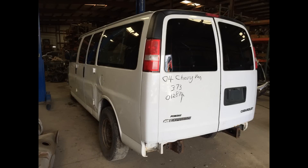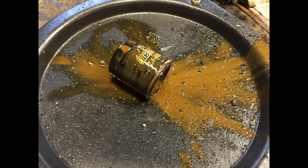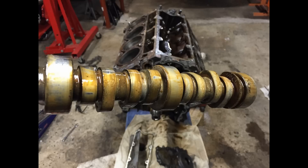My Thursday and Friday scramble was to pick up this motor from my buddy at Collis Truck Parts from an 04 Express van, which graciously gave its life. We picked up the motor in the Tacoma, brought it home, and started to tear it down. The oil was very milky and sludgy, so we took it all apart and looked for cracked heads and everything but couldn't find it. We concluded that some water must have gotten in the motor at the junkyard and made all the oil like pancake mix.